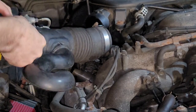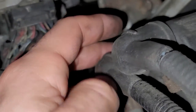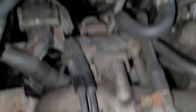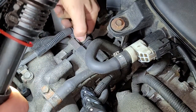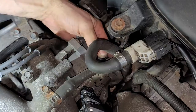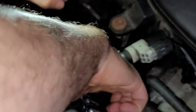We've got the ignition coil cables here. You have to pay attention to the order they're in — it goes one, three, two, four — so I should probably label these because I know I'll forget. Now this, this right here, is big brain time. We're just going to unplug them now. They should pop right off, maybe with some struggle. I'll worry about number four a bit later — it's quite difficult to reach.